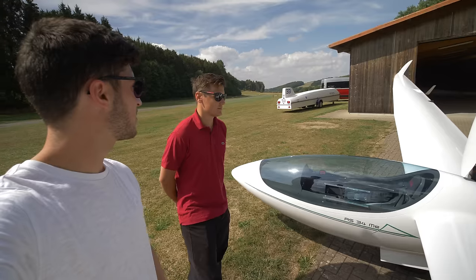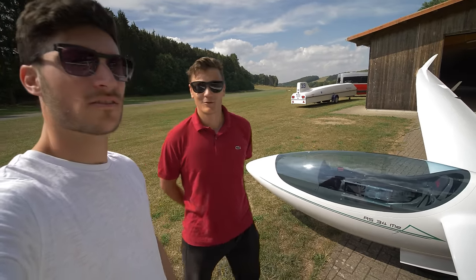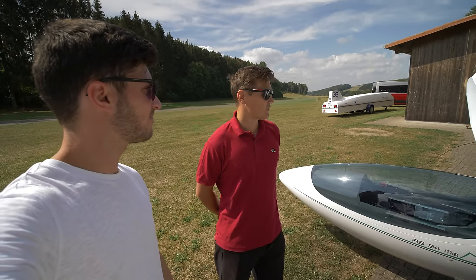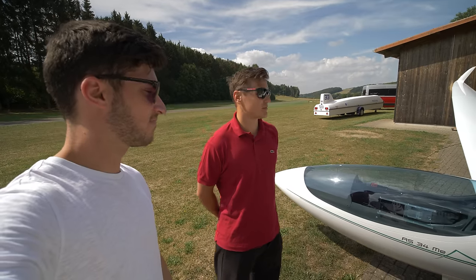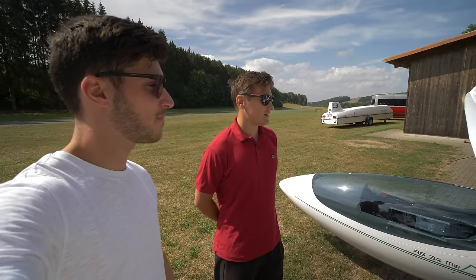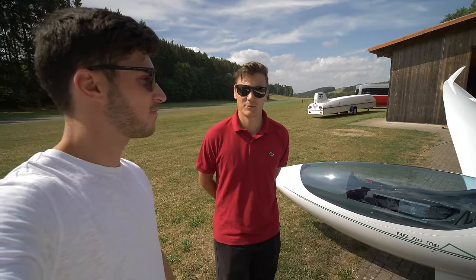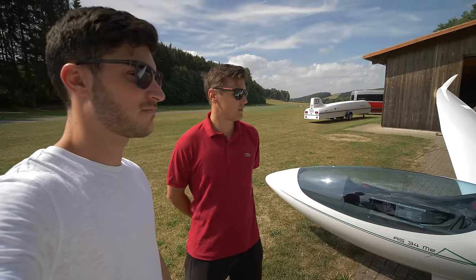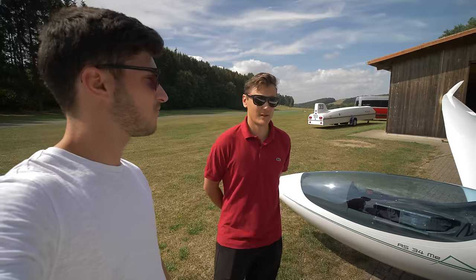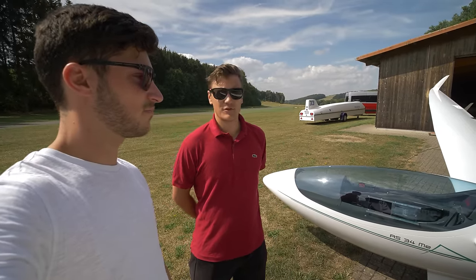What is the climb rate? In the beginning it depends on whether you start with tailwind or headwind, but with full power you have around 4 to 4.5 meters per second of climb speed. After that, you have well over 2 meters per second of climb speed at 25 to 27 kilowatt, which is more than enough to gain height and get safely away from ground level — a really good safety feature.